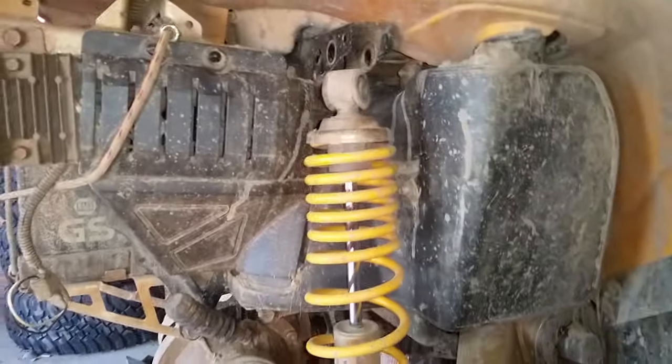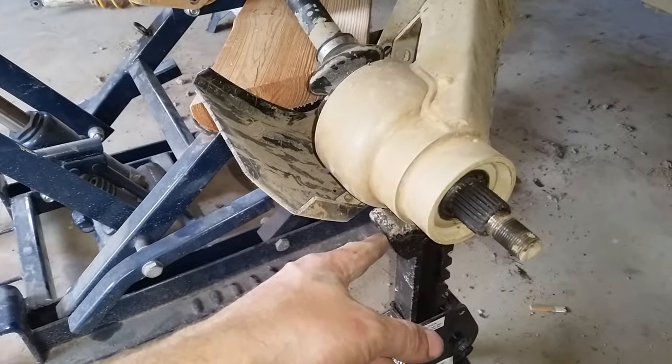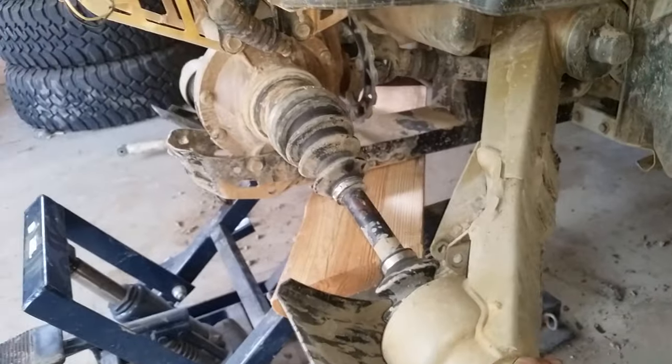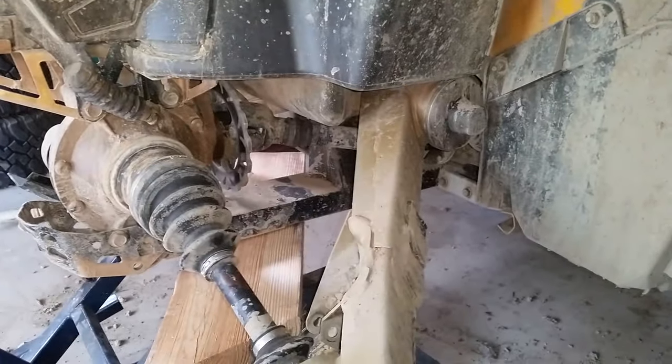Once you take your shocks off, right here it would be up in here — two 15mm bolts. You want to take your hub off; it's an inch and a sixteenth. And then once you have that, you want to put a jack stand underneath before you take your shock off because there is a lot of movement in here. If yours doesn't move this easy, it's probably because your bearings are about up in your trailing arm.